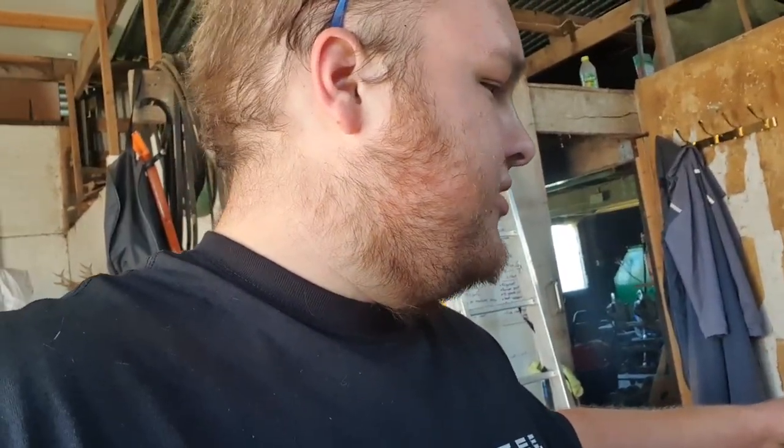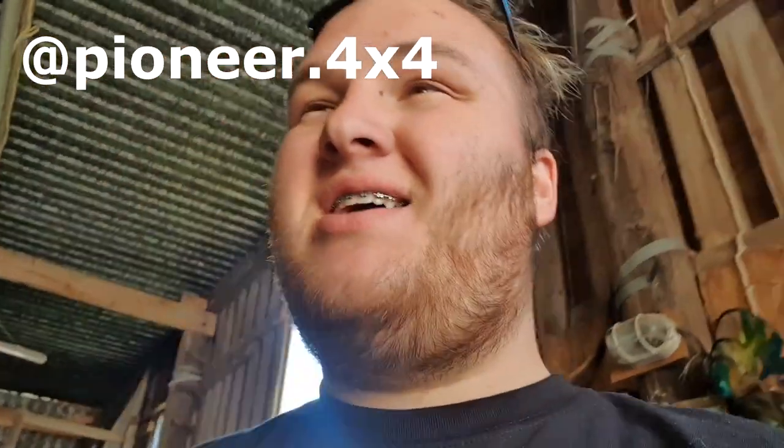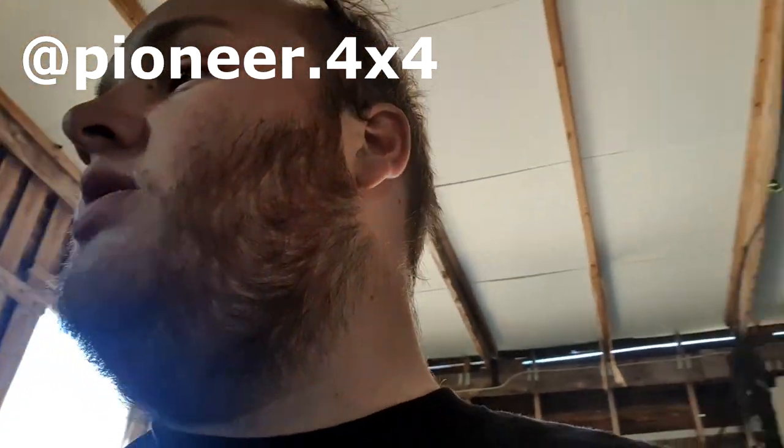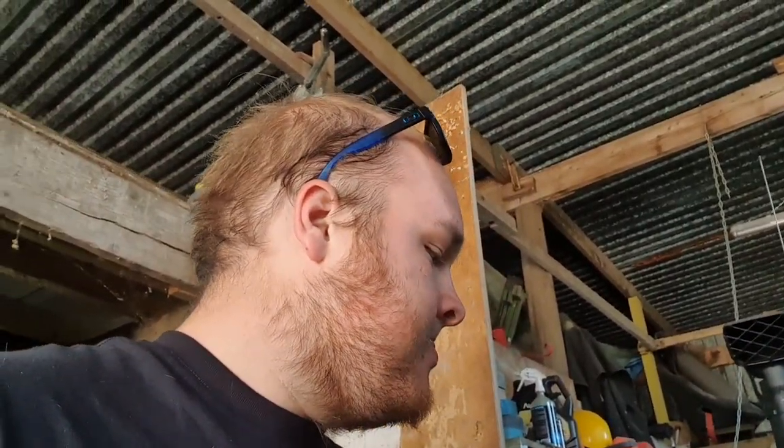What else have we got on there at the moment? Most recent part, it literally turned up yesterday, which is testament to the good service of Pioneer 4x4, is my extended turbo drain. So with the manifold, the turbo drain was ever so slightly too short, and what happened was I couldn't fit the turbo the way I wanted to. And yeah, I needed a new extended turbo drain.